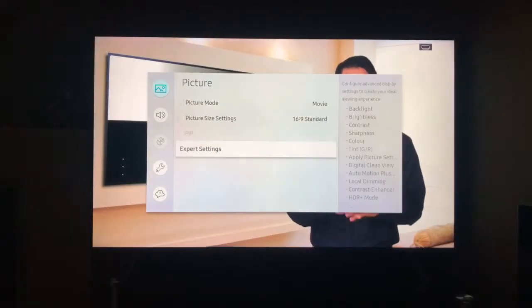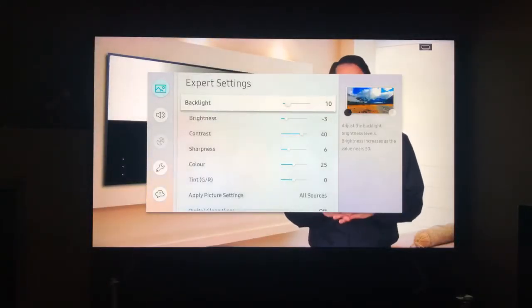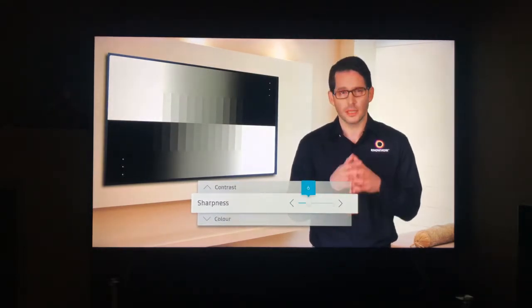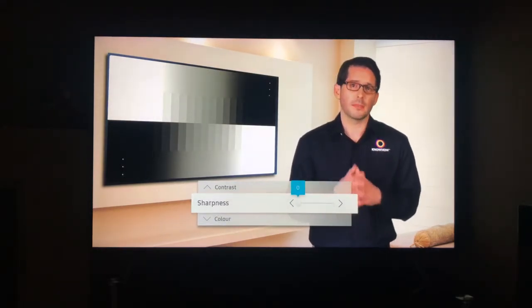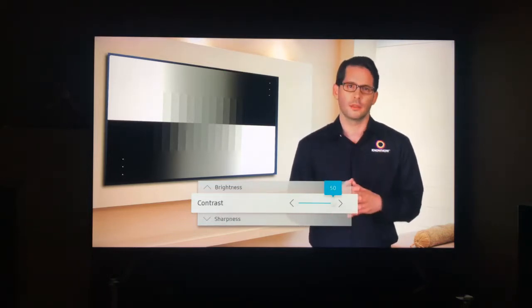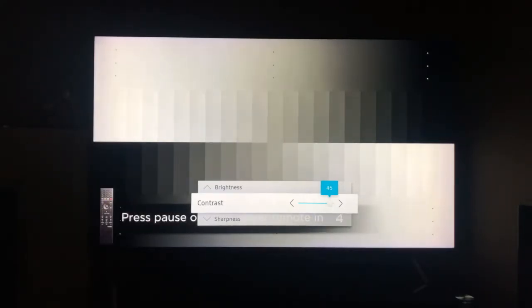If you can't get all of the steps in the darkest range to display, which is quite possible depending on the type of your television, this is okay. In this case, make sure that you can see the steps between white and above white. Just do your best here to maximise the total number of steps displayed in the grey scale. Don't forget to pause the pattern before making your adjustments.